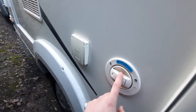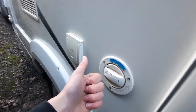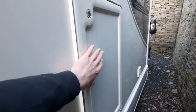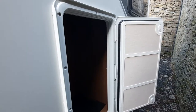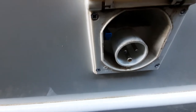With your water, I recommend always draining it down when traveling off site — you don't want to be traveling with water in your system as it will affect your payload and weight distribution. On this side you've also got some additional storage. Finally, you've got your mains electric hookup point — your 230 volt — which you'll be connecting to when on a site.